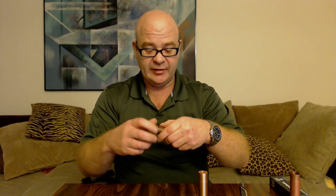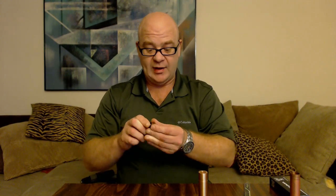We're going to use that nipple, but first — here's another Overdose and the pin seems to be pretty tight on this one. So what I'm going to do is take the pin out and loosen it up. I'm going to show you guys how to do it. The Pegasus is very similar except it's a little bit more tricky because the Pegasus contact pin does not have a nipple that is at all significant — it's a lot smaller so you really can't chuck that one up in a drill to sand it down. I tried it and I couldn't, so I came up with another way, and I will show you guys in a second.